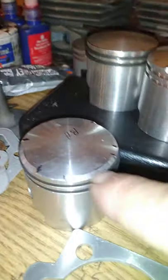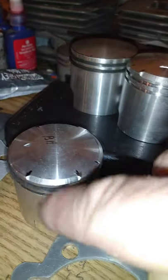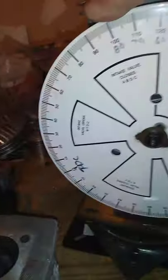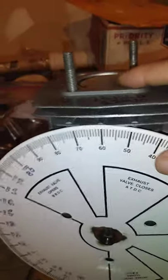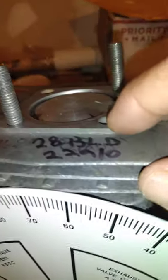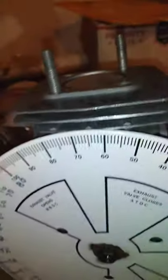That makes me happy — so much better. I don't lose any compression with the ramps. Somebody keeps asking if I stagger my ramps to make them open evenly — no, that's near impossible. Having a staggered ramp would be stupid. I look at port separation. What happens now: I retarded my transfers, increased my exhaust duration, increased my transfer duration. My transfers are now set at 120. My next move is to determine how much I need to deck off the cylinder. With the head gasket everything torqued, I check the space, then remove material and set my squish at about 0.75 to 0.85 by decking and choosing my base gasket.